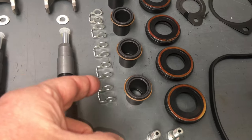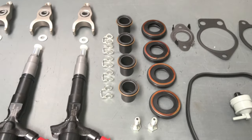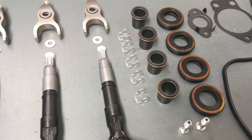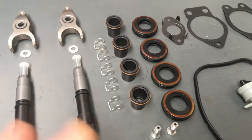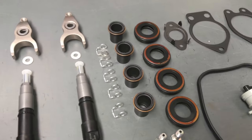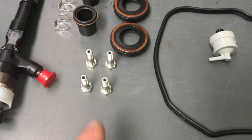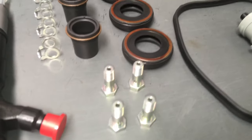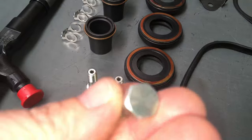These are single use only - the little return line gaskets on the fuel line. You can reuse the fuel line under the valve cover, just as per our videos in the VIP group. Do your checks, make sure it's straight, not bent, put some oil on them. It's single use only - once you tighten those up and take them off again, you should be replacing them. We also upgrade the bolts again, only if you ask for it. You don't have to do this, but because we're a bit OCD fussy, we upgrade to the later ones.